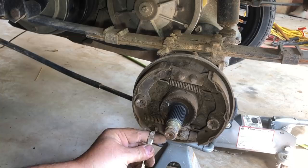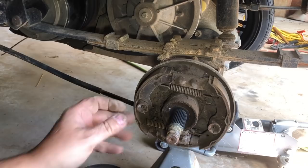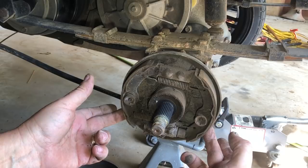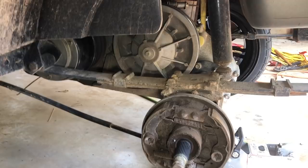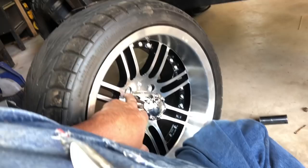So what are you doing now, dear? I'm spreading these brakes out. This brake is bad and it's a little low on this side, so I'll have to put brakes on before too long. Should I go get them now while you have all this off? No, I've already spent 200 bucks on tires. I just had to buy longer lug nuts too because the regular size lug nuts won't fit in these holes — so I had to buy longer ones.